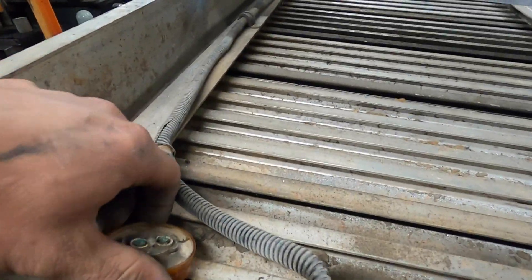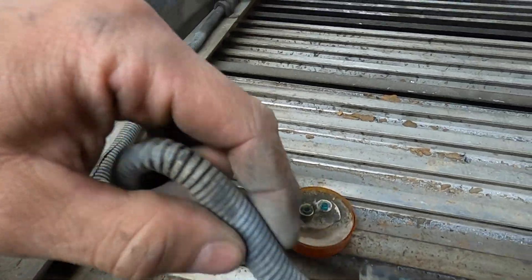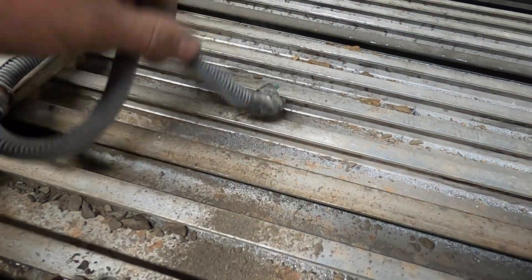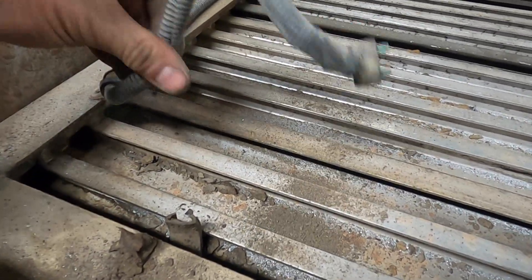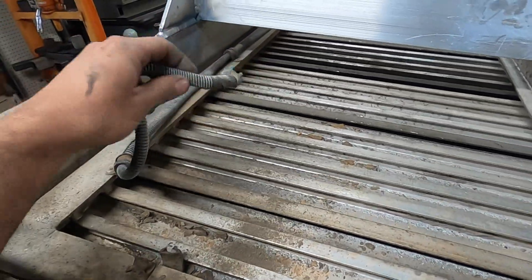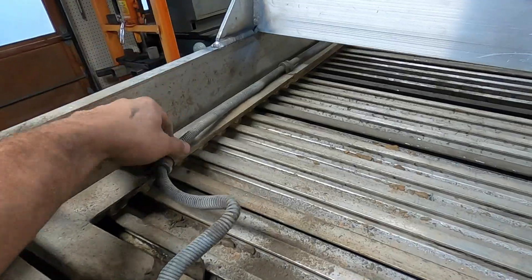This is what I'm talking about — this one didn't work, all corroded. You can see here, same thing on the plug — everything's corroded. It must have been like this for years. There's a ton of dirt in the loom; you can see it's all just flaking out as I'm messing with it. Definitely worth the time to mess around now and get all this sorted.